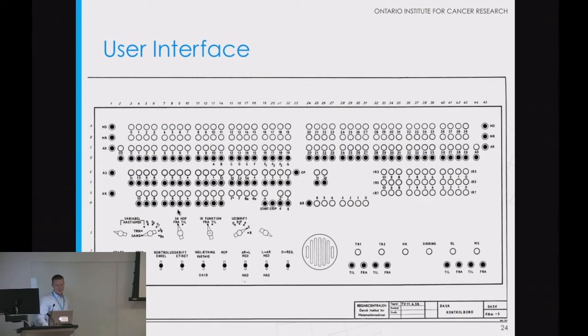Here you can disable jump instruction 56, and this is a function for disabling the jump registers, but they said they removed the button so people couldn't use it, because if you're running a normal program and you disable jump instructions, weird things will happen. So they probably regretted putting it on, so they just took it away.